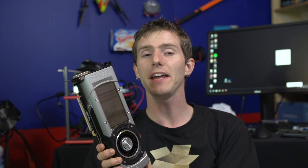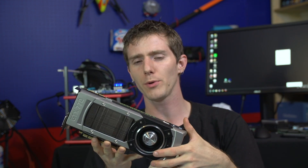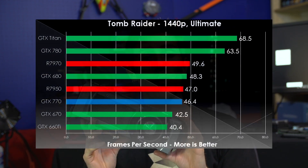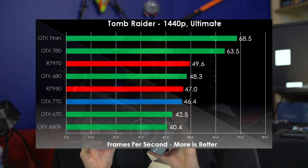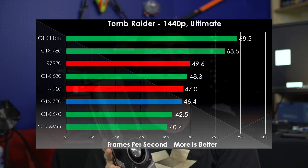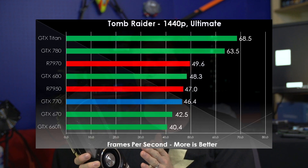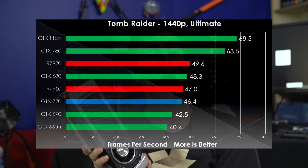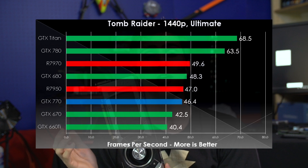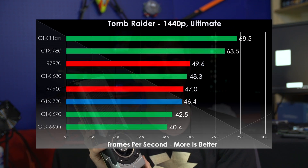In Tomb Raider, we see a hint of what we saw in our 1080p performance review, where the GPU Boost on this card isn't that competitive with the way our 680 turns up when overclocked. We overclock all of our cards for performance testing, and what that revealed was that our GTX 770 is not necessarily faster than our 680 once both cards are overclocked to the max. I'm expecting this to change with some tweaks, and most 770s should boost higher than our particular one — remember, this is a higher TDP card, able to draw more power, with a higher stock clock speed and faster memory.